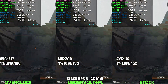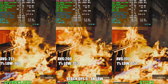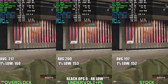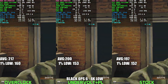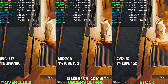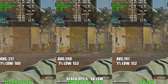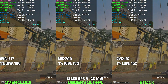Let's pivot and take a look at a multiplayer game — Call of Duty Black Ops 6. This game is interesting because I was benchmarking at 4K but with low settings, so the game just isn't demanding on the GPU, and power draw across the board is drastically down compared to the previous games. With that said, we still get a nice benefit from power tuning the 5080, as we're only drawing around 180-220W versus 250-280W when the card is stock, and performance is basically identical.